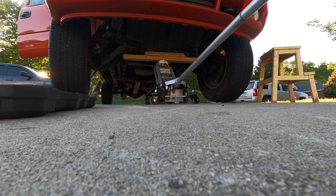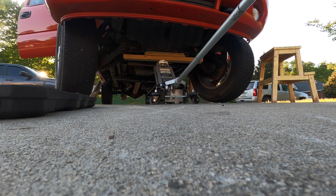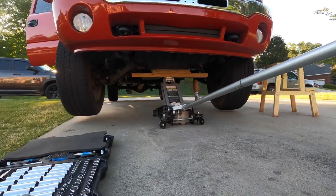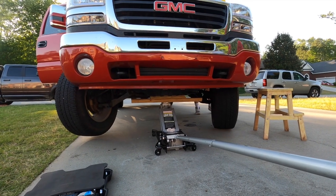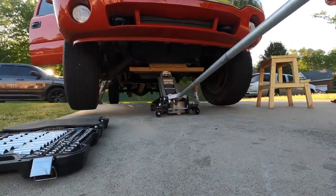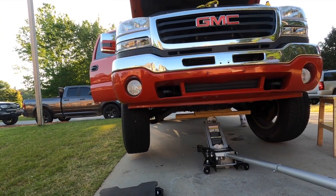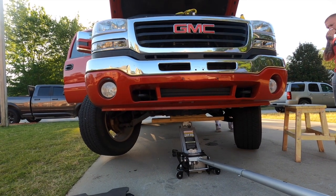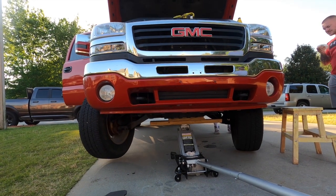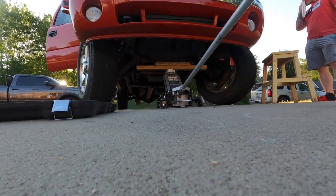You can't sit in it — just turn the steering wheel. What I'm doing right now is I'm just turning my steering wheel to the left and to the right, kind of back and forth, and then pumping on the brakes a little bit. Apparently this is the best way to bleed your Hydroboost system. For some reason this whole time I've been thinking we're working on brakes — that ain't bleeding no air out of the brakes. Makes more sense now.